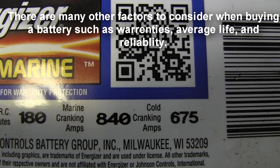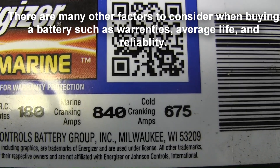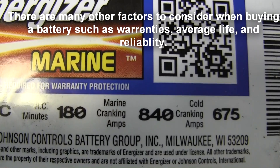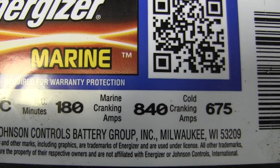However, if you have a gas powered motor that takes 1000 amps to start, this battery won't be able to do it because it can't put out enough burst amps in a 30 second interval. You'll notice there are 2 different types of cranking amps with very little difference between them: marine cranking amps and cold cranking amps. Marine cranking amps are always about a third higher than cold cranking amps, because marine cranking amps were calculated at 32 degrees Fahrenheit while cold cranking amps were calculated at 0 degrees Fahrenheit.